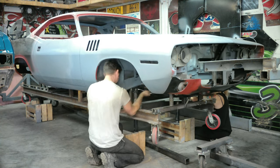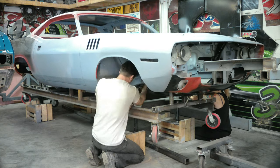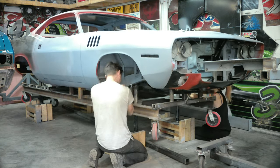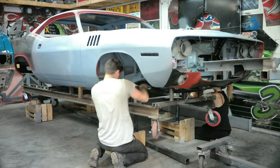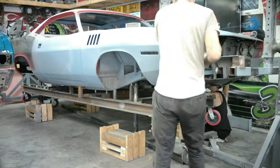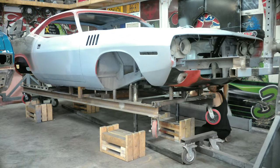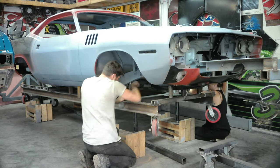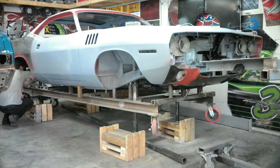The first step is to take our legs — trailer jacks with nuts welded in the tops — and we're screwing them up at the same time. We're going to get them to the same height as the rotisserie arms and walk it in. I've had this system designed for a long time, even before we had a lift in the garage, to make it easy and practical.